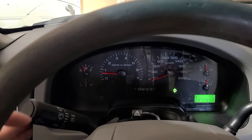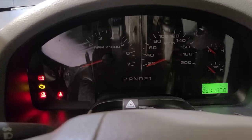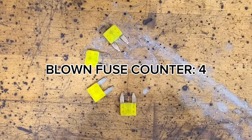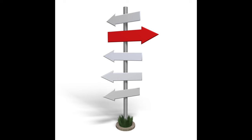At this point I was convinced the truck was smarter than me. I popped another fuse in and thought maybe it blows while the truck is running — still not popping while running. Again I tried to take it for a drive, and to leave the garage I pressed the brake. Finally we have a direction — it seems the fuse is blowing when I press the brake. So let's get the kick panel off and inspect the brake switch wiring.